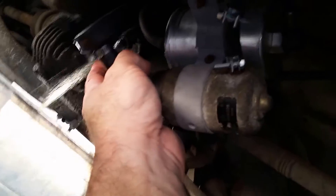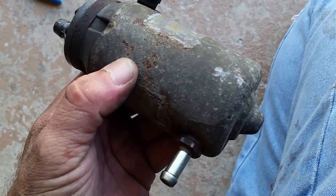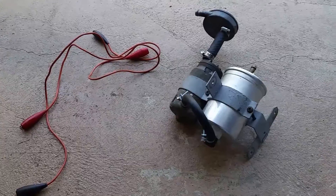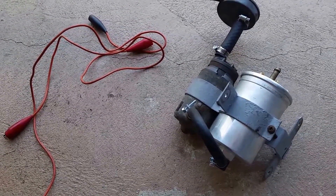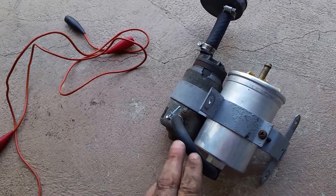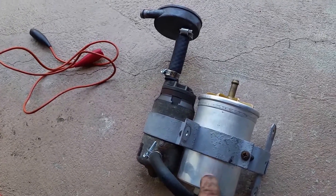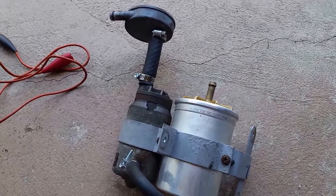We're back for another round on the Mercedes. We ran into a whole set of problems — I put the pump, filter, and everything back on the car and now it's not pumping any fuel. Pulled the pump, it wasn't working on the car and wasn't stuck through the tank — tank had plenty of gas. Bench tested it in a small container: ran the pump and it pumped out at 55 psi, good steady pressure. Ran it through the filter and damper — still pumping great, right around 55 psi, nice quiet pump.